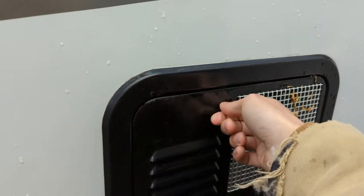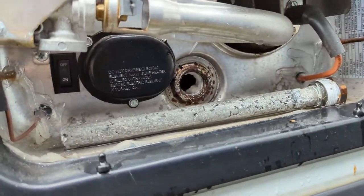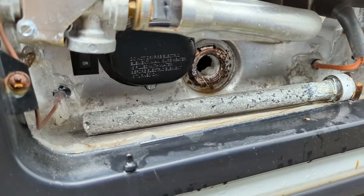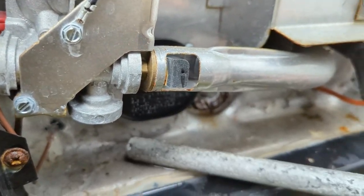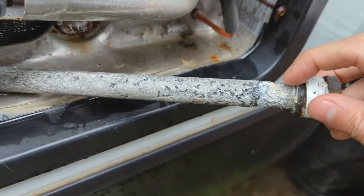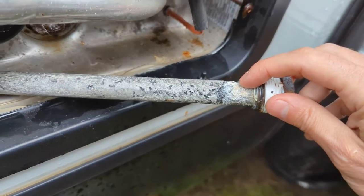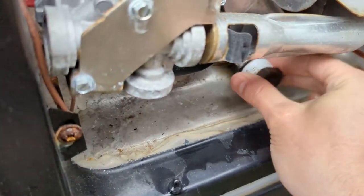One of the first things I'll do is walk up to the water heater door, open this up, and you'll see I left my anode rod open because I drained and bypassed the water heater over the winter. All I'll do is inspect this and make sure it's still good. Mine typically goes here first as far as the sacrificial rod — it'll be down to almost nothing, which tells me it's time to replace it. This one looks fine, a little build-up but overall not too bad.